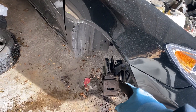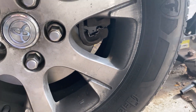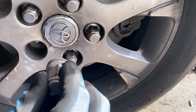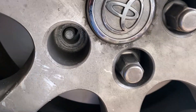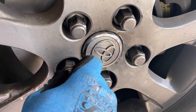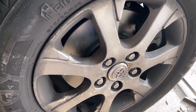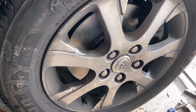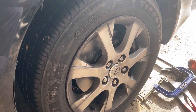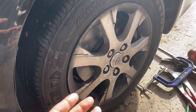Now I'm going to turn the ignition back on and straighten the steering wheel so we can get the wheel back on. Reinstall the lug nuts — in this case with the 16-inch wheels, that was a 21 millimeter. These little posts should help center the wheel, but make sure the stud is centered properly in the hole before snugging down. I recommend jiggling the wheel, starting them by hand, and snugging them down before you drop the car. According to multiple sources, the torque spec for this is actually only 76 foot pounds, or 80 if you want to round up — that sounds low to me.